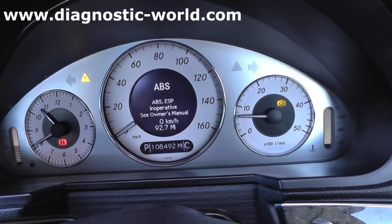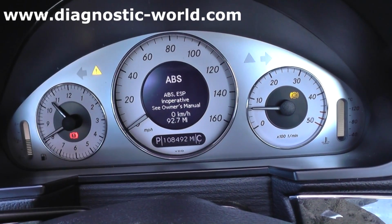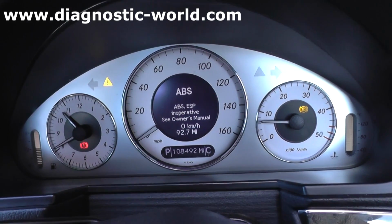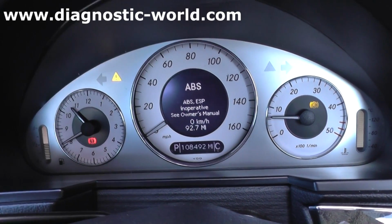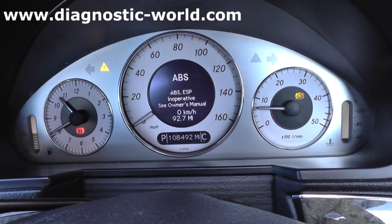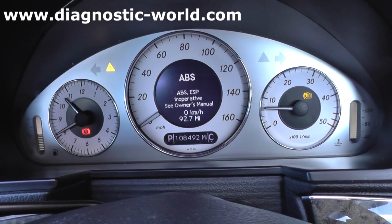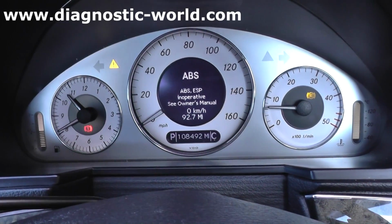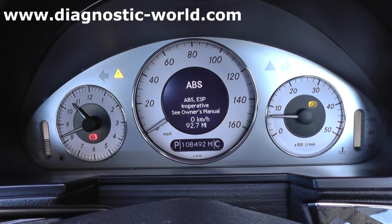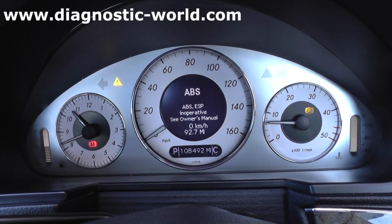Now, there are a few areas where the problem could be. First of all, it will most likely be an ABS sensor. There are four ABS sensors in the vehicle, one on each wheel. We have the ABS module and we also have the ABS pump. Now, the hopeful scenario is that it would be an ABS sensor, because these are generally the cheapest to replace. If you need to replace an ABS pump or an ABS module, that's big money, especially on one of these cars. So fingers crossed that it is going to be an ABS sensor. Now, what we need to do is hook this up to a diagnostic tool, first of all to find out which ABS sensor is at fault.